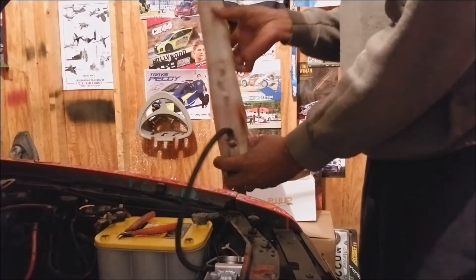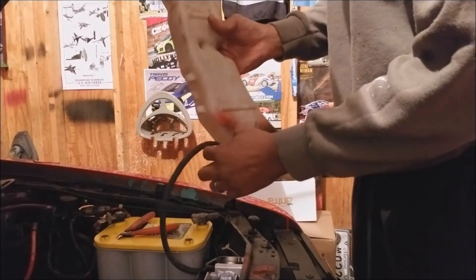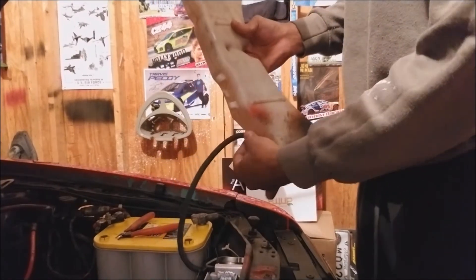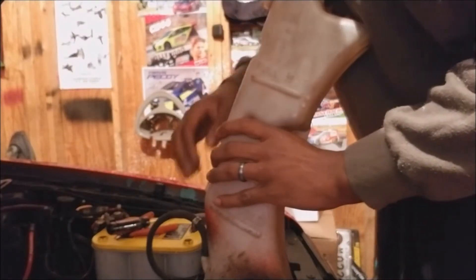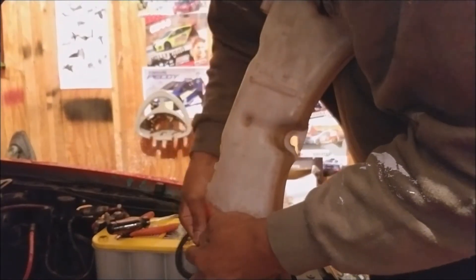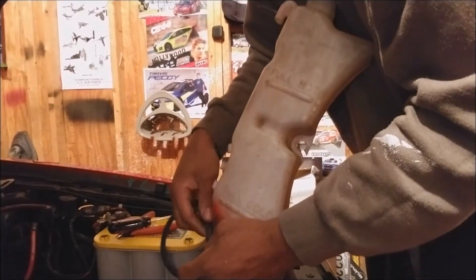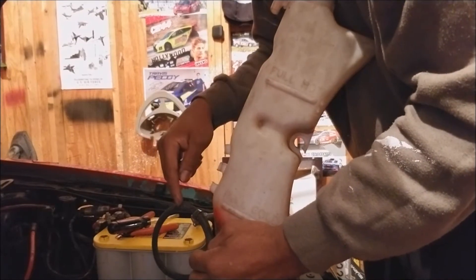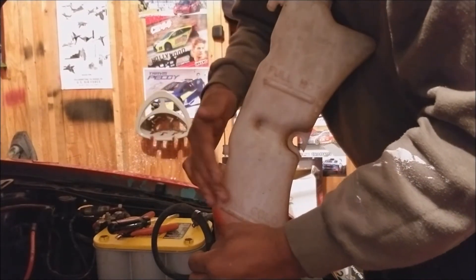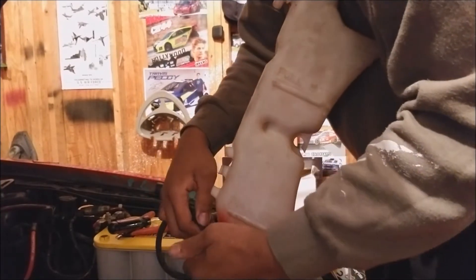To get this loose you'll have a hose clamp on the bottom — disconnect that or cut it loose if it's super crusty. It's not going to spray out. Don't ever do this if your car is at running temperature — you definitely want to do this on a cool car. I'll disconnect it, cover it with my finger, and keep the mess to a minimum.